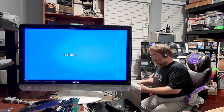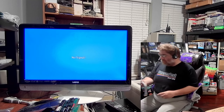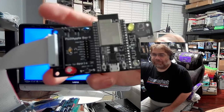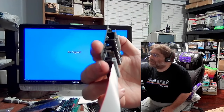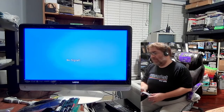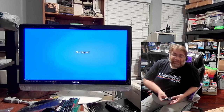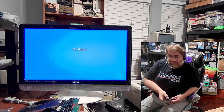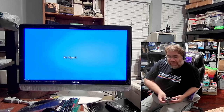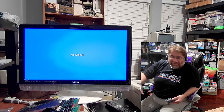The very last Apple SmartPort device I have, and I'm really happy to show, is this RevZero FujiNet Apple. It's a standard DB-19 SmartPort port, it's got Wi-Fi — I believe it's an ESP32 — and it has an onboard SD card if you want to load from that as well. The really cool part is this gives multiple devices to SmartPort for the very first time as implemented for the Apple. It's part of the protocol but never really done before — a network device, a character device, and block devices for the protocol. There will be more demos on Friday with Jeff Peepmeyer.